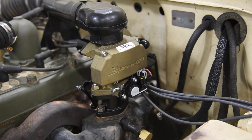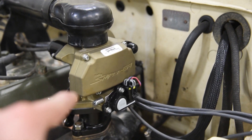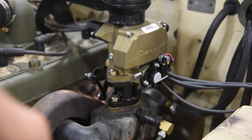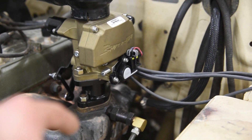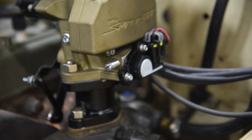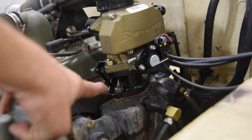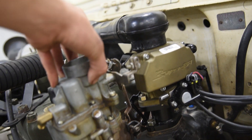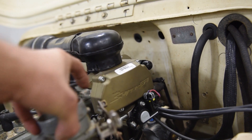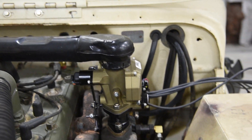We've got huge progress on the Sniper itself. A guy from work used a CAD program to make the bottom flange of the original carburetor, replicated the flange on the Sniper, and had a laser machine cut out two of those flanges — about 3/8 inch thick so they don't warp and cause a vacuum leak. In between those two flanges is just a piece of tubing that extends the Sniper system up in the air and actually matches the original air cleaner horn very well. When deciding how tall to make the tube, we held up the original carburetor and pretty much matched the height — if anything, it's maybe a quarter inch shorter.